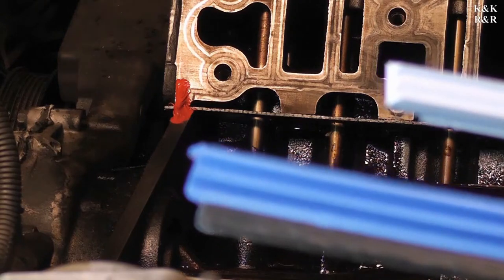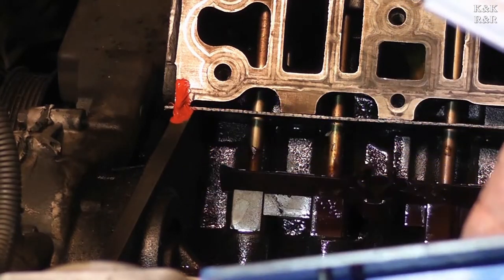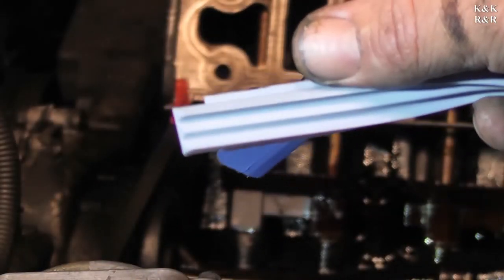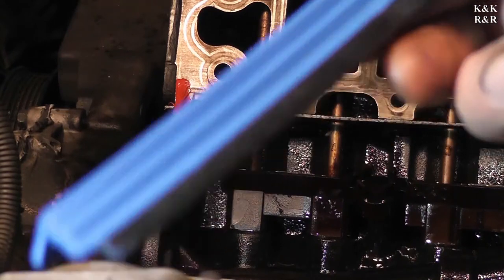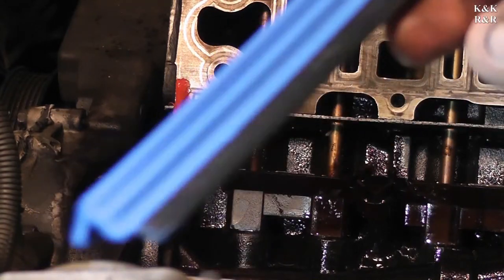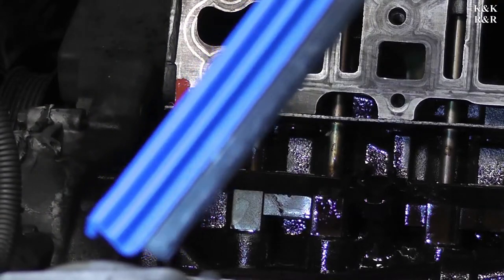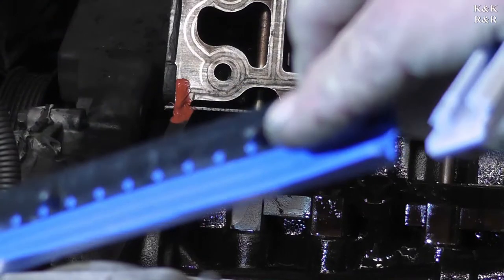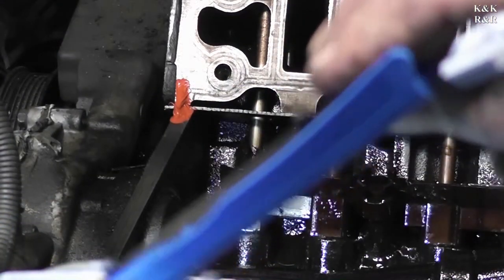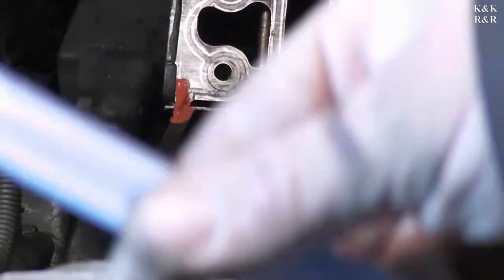On the GM 3.8 Series 2, there are two styles of end gaskets. 1995 through 1997 use the light blue. Before that, use this one. This one we're not going to use — it's an extra part. That one's from '97 and above. I believe that because this actually has to have a block provision, which we don't have clearly. So these — garbage. We use these.